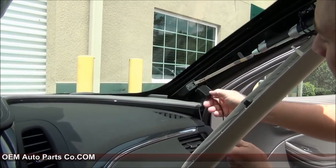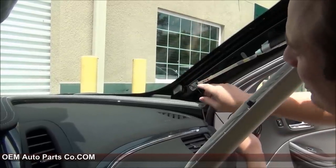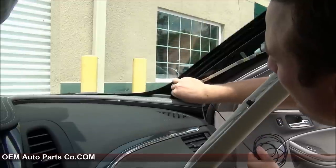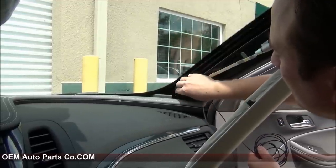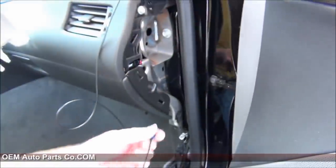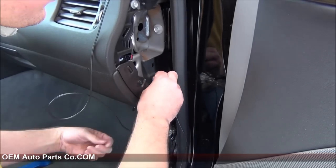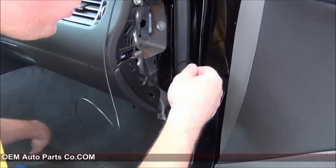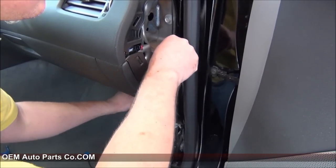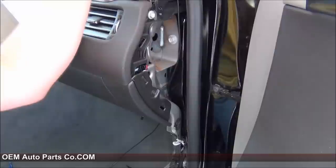Now we can install the GPS antenna. It has a magnetic base, so it works really well if it's attached to a metal surface. You can also use double-sided tape or Velcro, but the magnet works really well. Stick it right about here so it can still get signal through the windshield. Then tuck the wire back over here along the A-pillar. Now we just fish the blue connector from your GPS antenna down this little crevice right here. You can reach underneath and pull through the slack. We'll now reassemble the right side of this dash by popping in that trim panel and then the right A-pillar.